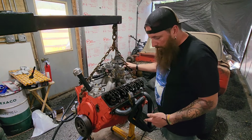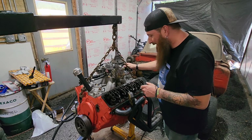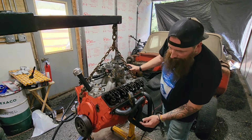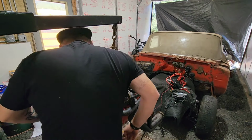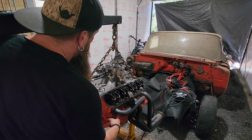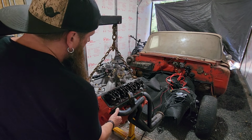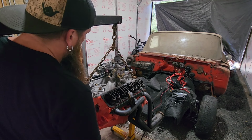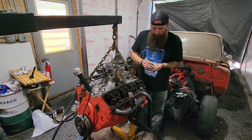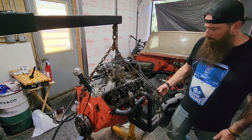Right there. And even just doing that right there, clicking it over, some fuel sprayed up out of the carb. So I'm still not understanding how that's happening. There's definitely something wrong here. But we got this in here, and we can bring it back around to top dead center now. Compression stroke, number 1. That should orient that rotor right back at number 1 again. Fuel sprayed up out. There's compression building right there. Top dead center and pointing at number 1. Alright, let's get this distributor mounted down. Alright, now let's go ahead and run these wires to the right plugs.